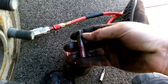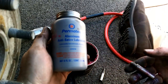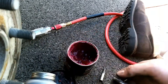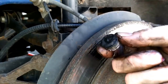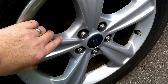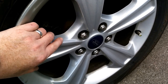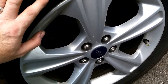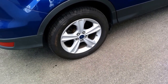One final tip: grease your slides up really well, and put some grease around the threads to keep them from rusting. You could even use anti-seize — it's a great Permatex product that keeps bolts from rusting together. I'll put a link below. Don't forget to put your dust caps back on to keep dust out of the slides — they need to be free and well greased. Once the wheels and lug nuts are on, get in the car, keep it in park, start it up, and press the brake pedal a few times to reset the calipers. Once they snug up you'll feel it in the pedal — take it for a test drive and make sure everything's okay. After driving a bit, come back and re-torque your lug nuts. It's a pretty easy, inexpensive job — about $30 to $40 in parts if you do it yourself.